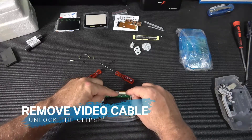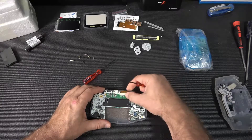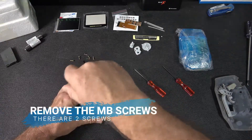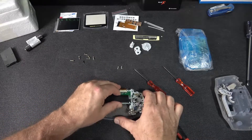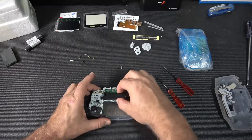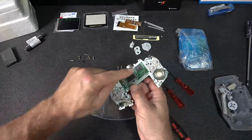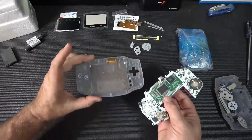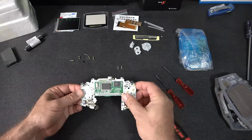When removing the video cable, take two fingers and pull it out. The two clips — take a little screwdriver, be very careful, let it release. If it's not pulling out easy, make sure the clips are released. Remove all the old parts — the kit comes with all new silicon contacts, brand new D buttons, brand new A/B buttons, brand new everything. Don't throw the old screen away if it's still good — it might help you refurbish another unit.